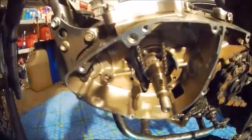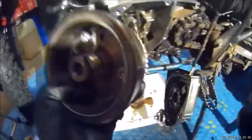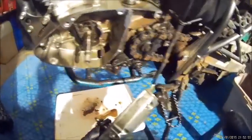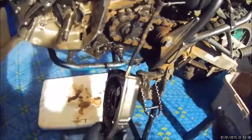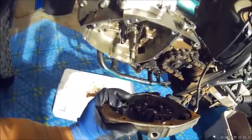That's as close to TDC as it gets — cams are down. Next up, I'm looking for the hash marker right here. I'm going to put that on, and then we're going to have to put on the stator cover. We'll look through that hole, and if the line is visible through that hole — you can see the arrow — then we're at TDC and we're good to go. Ready to rock and roll.